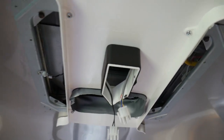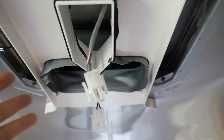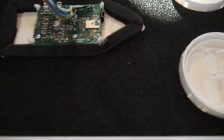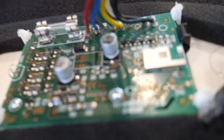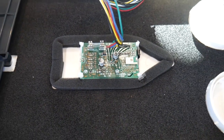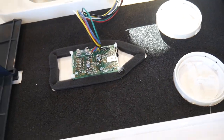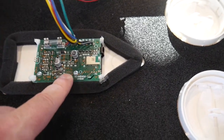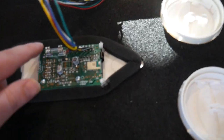The controller board is mounted way up here. I got a couple of L brackets and mounted that controller board up underneath. Here's the bad board — you can see there are two capacitors: the low cool circuit and the high cool circuit. This was not easy to get out because they had hot-glued all four corners to the circuit board. I had to use an exacto knife to get enough of that glue off. The new one snapped in, but I need to get more hot glue because when you push on the other side it can pop right out — which is exactly why they hot-glued it originally.